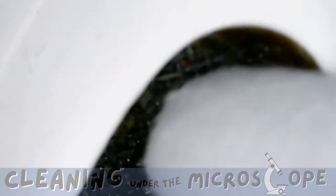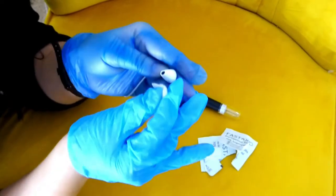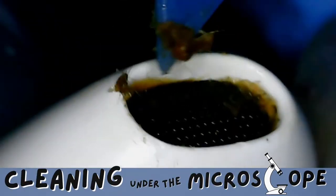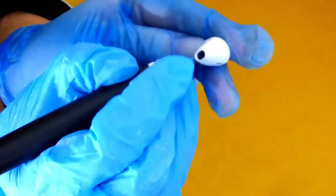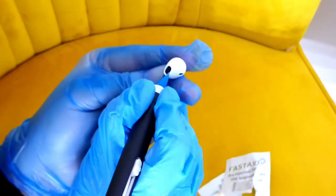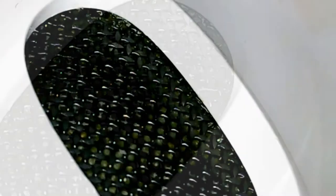The reason these swabs are really good to use is because the alcohol is super fast drying. You never want lots of moisture in your earphones or ear pods because it can damage them. Turn the swab into almost like a cone — a triangular shape — so that you can fit it inside where all the gunk is. Once you've done that, you can go ahead and use your OXO Good Grips to pull out any extra earwax. This silicone tool is good because it's not hard enough to damage the earphones. Some people use toothpicks and it's not advised — this is why the silicone-tipped brush is really useful for this particular cleaning task.